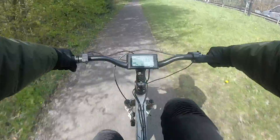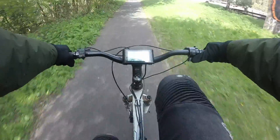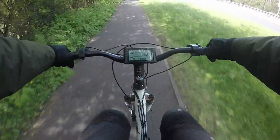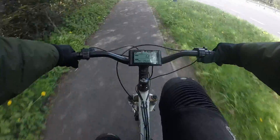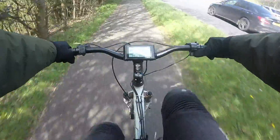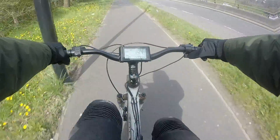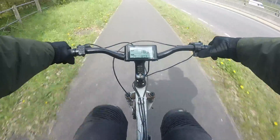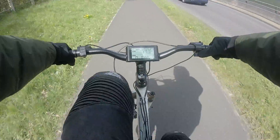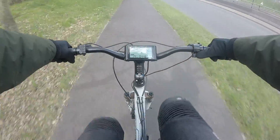With the very small battery pack I'm only using four amp hours worth of batteries. I've basically got three lithium polymer batteries from my radio control planes: two 4S 4000 milliamp packs and one 6S 4000 milliamp pack. I've forked them all together for a total of a 14S cell pack - so 14S 1P - so the mileage isn't that great. I can get about six miles depending on if I pedal with a little bit of throttle.